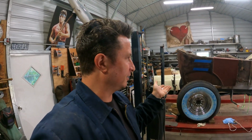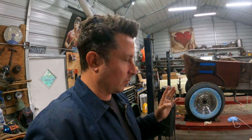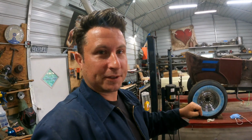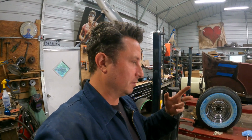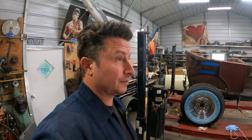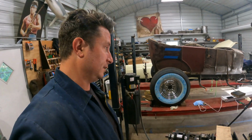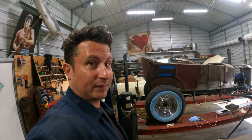It may just, you know, back burner to some other things that we have going on, but we will continue moving forward. Next up, finishing polishing this thing, then we'll get the bearings in, then we'll plastic gauge everything. I'm gonna put in stock rings, do a hone, all that stuff. And yeah, then we're on the hunt for the camshaft. So it feels a little bit like parts time and a little bit of mechanical labor time, and then assembly time.